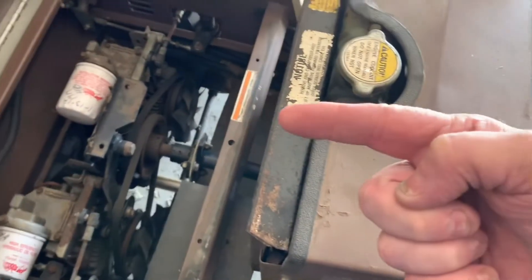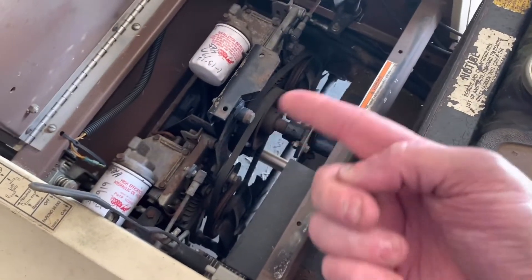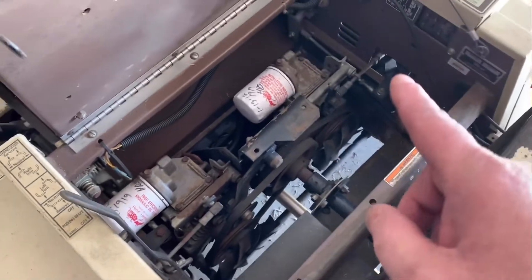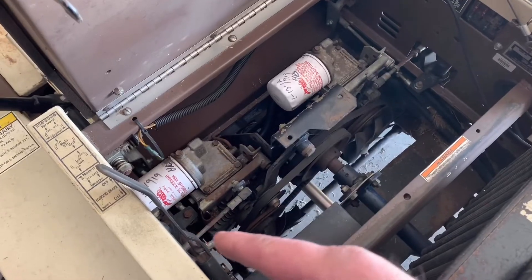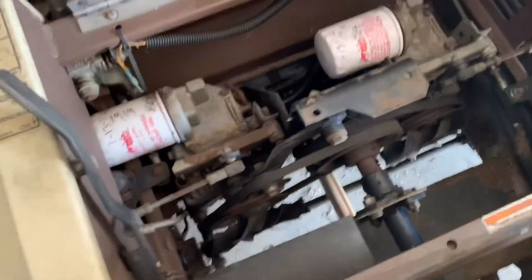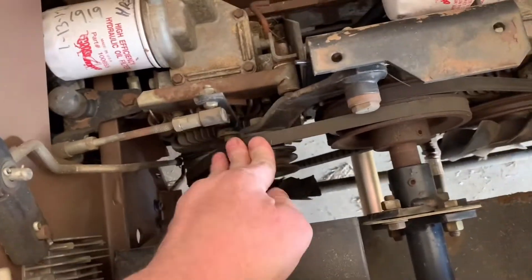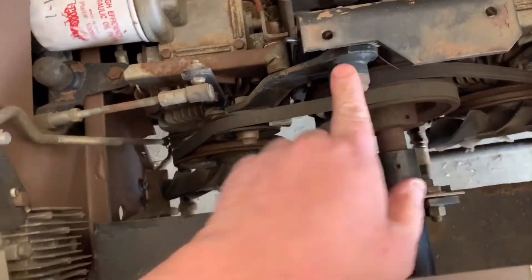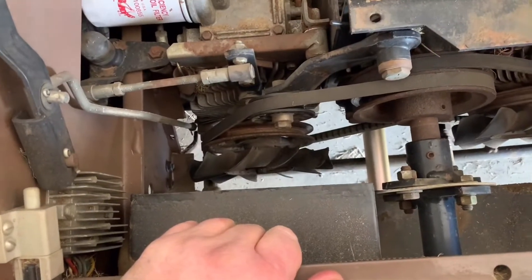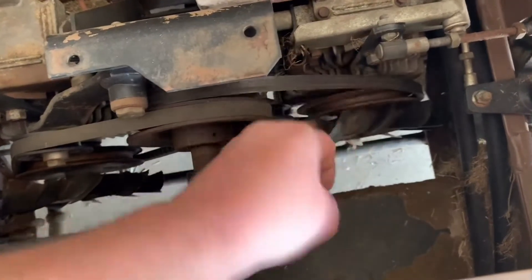What we've got is basically a three-cylinder engine with a shaft that runs through with a fiber flex disc. Here is the drive for the Gemini transmission — there's a transmission over here and a transmission here — and a double pulley. This spring-loaded idler right here puts tension on the belt for this Gemini transmission. As you can tell, this belt is loose as a goose.